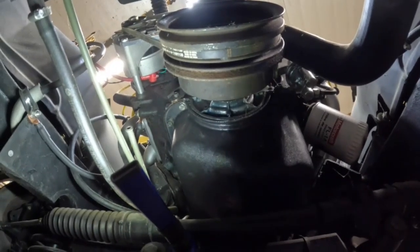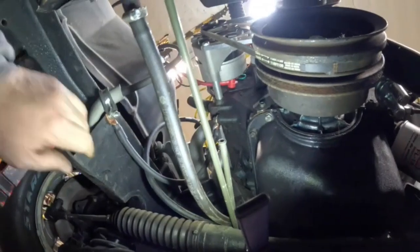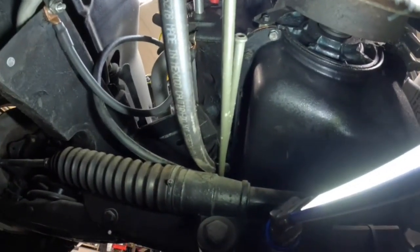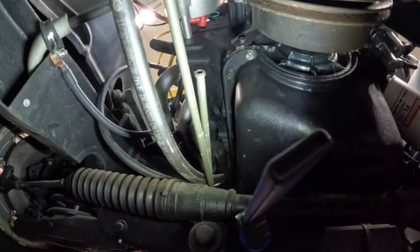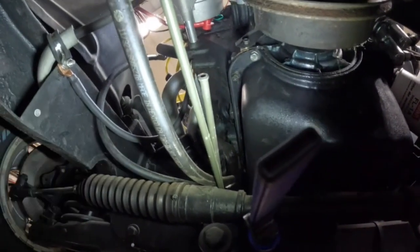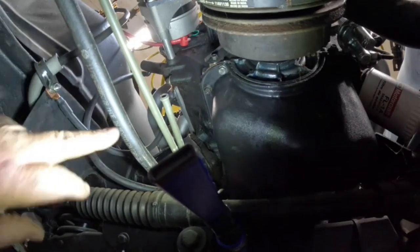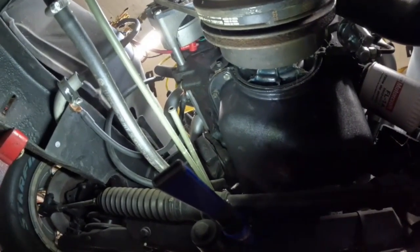And then we have a transmission cooler line on. So we can go mark off the grounds. Well, we got to check the ground from the cab to the frame. But the engine to the frame is a good thick ground. This is our starter cable. We got to hook that up too. We're going to do that now and cut this off and hook that up. So we can get this thing, I want to get it started tomorrow. We're going to try like hell.